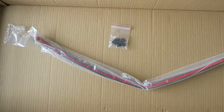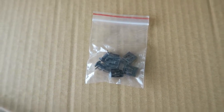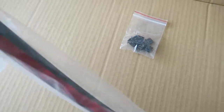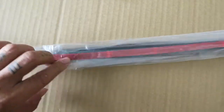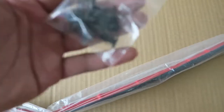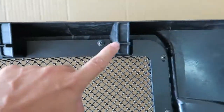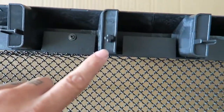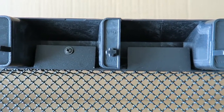The things you should get in the box are some new clips for the grill to clip onto the stock positions, and also a water protector that goes on top of the grill so water doesn't come through — it's stuck on by double-sided tape. As you can see, it runs through here, and these clips go on the back of the grill onto specific spots and clip directly into your car. There's also an X-piece liner that lines with the car and makes it very easy to put the grill back on.